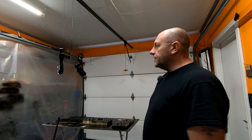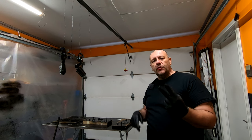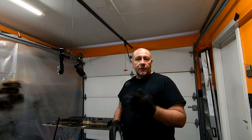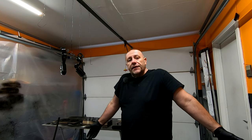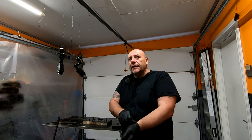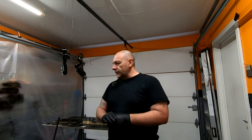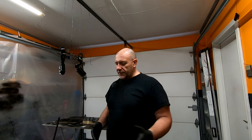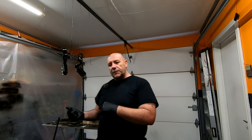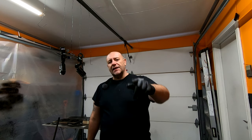These parts have been sprayed two coats on everything and it looks pretty good. I'm going to give these pieces two days to dry, then come back, hit it with the green scotch pad number zero, and then clear coat these pieces. I'm not in a hurry because I'm looking at a three-week turnaround from the powder coat place. On the next video we'll go ahead and take off some more chrome pieces that I want to get blacked out so when I pick up those other pieces I can drop these off. That's it for today — you all take care, God bless, and ride safe.